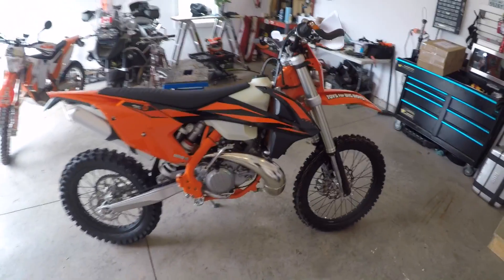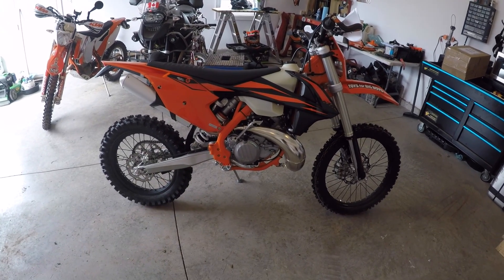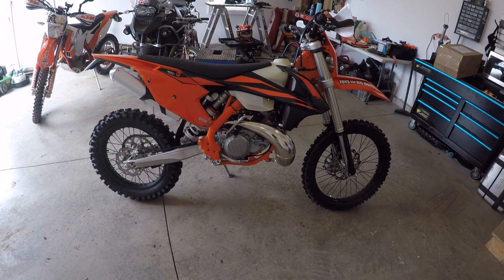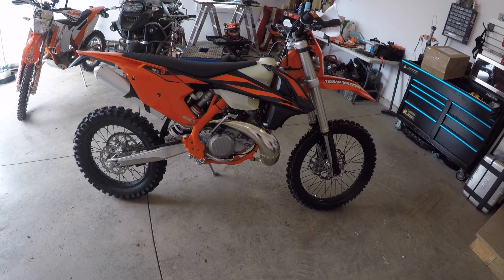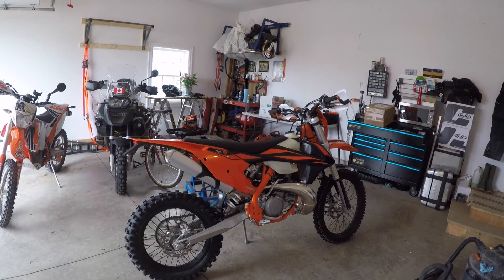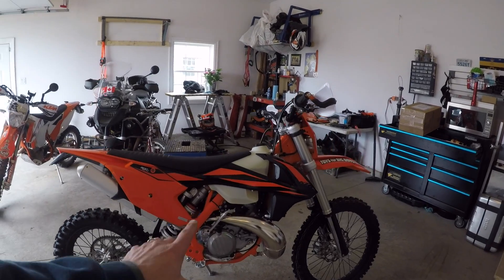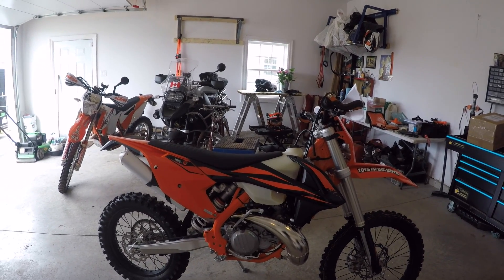Pretty good running up and down the street a couple times. What I can say immediately is that this bike is a lot more rangy than the demo model I test drove. By rangy I mean there's a lot of snap to the throttle — this thing doesn't like to idle along at a fixed speed, you're on or off, unless you run in a higher gear. I'm sure after it breaks in that'll smooth out, but that 300 two-stroke versus the 500 four-stroke — this is a rangier bike. I suspect the demo model may have had the more docile fuel setting on.